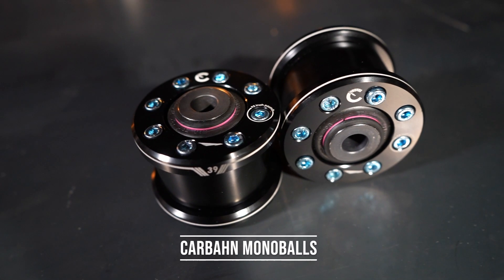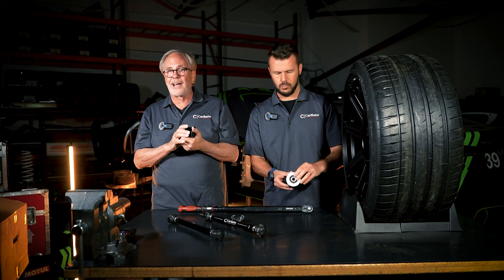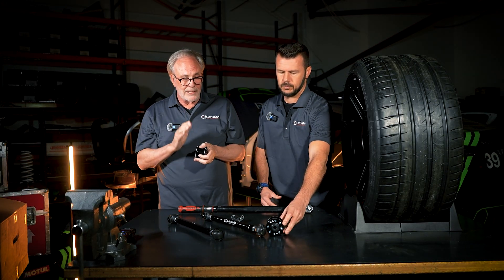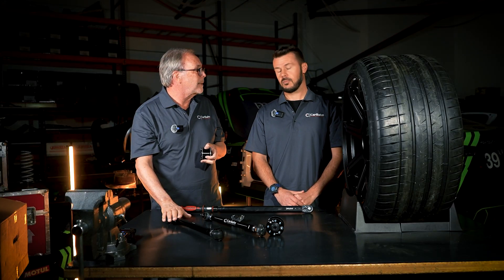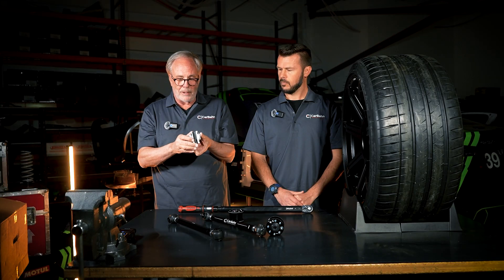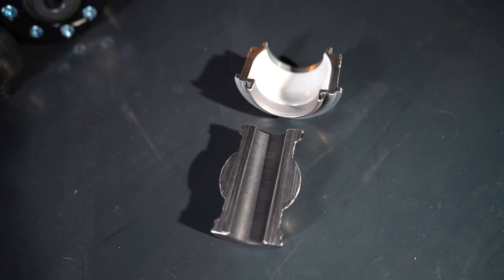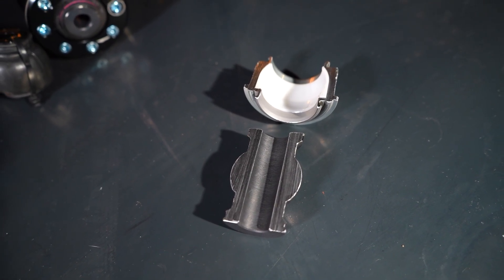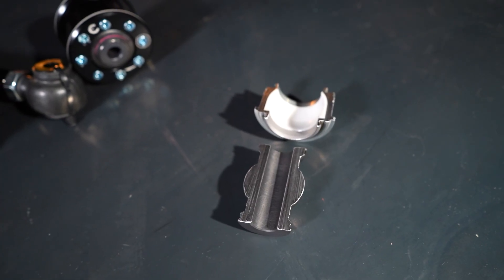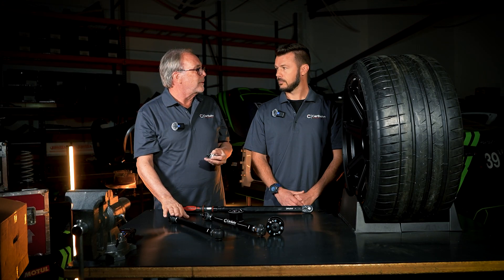What we do is put a through ball joint here. The reason we use a through ball joint instead of a rod end or monoball like you'd have on a race car is we want it to have a little give, because it's absorbing energy longitudinally, not laterally. A rod end would transmit even more noise into the car. So we use a through ball joint — we cut one apart here for you to look at — it has a liner inside that makes the joint quiet and absorbs some energy. It has a little more play than a monoball, but this is a street car not a race car. It takes about 90% of the play out but with far less noise.